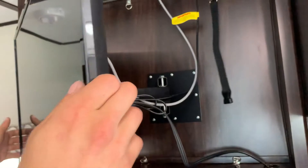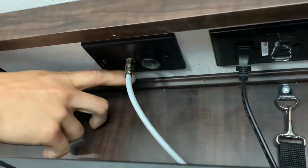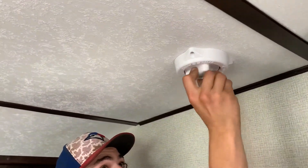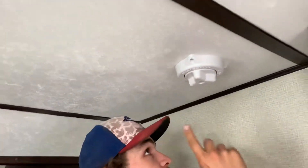The TV here has just the one latch — you can pull it off and point it wherever you like. It does have full motion. Right above it is your antenna control — that little button there, you can see the green light. If you press that button to turn it off, that's your antenna turned off. Up in the front, this dial is your actual antenna — press up and you can turn the antenna to look for your best signal. Whenever you're traveling, make sure it's fully rotated to the side as indicated.